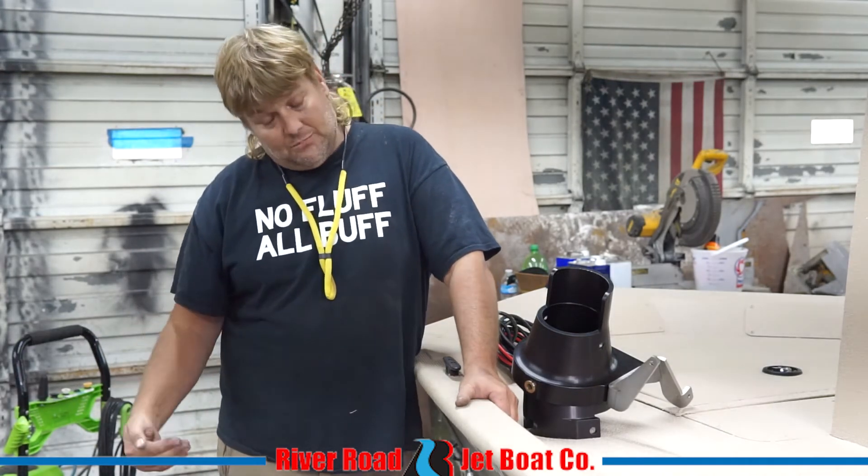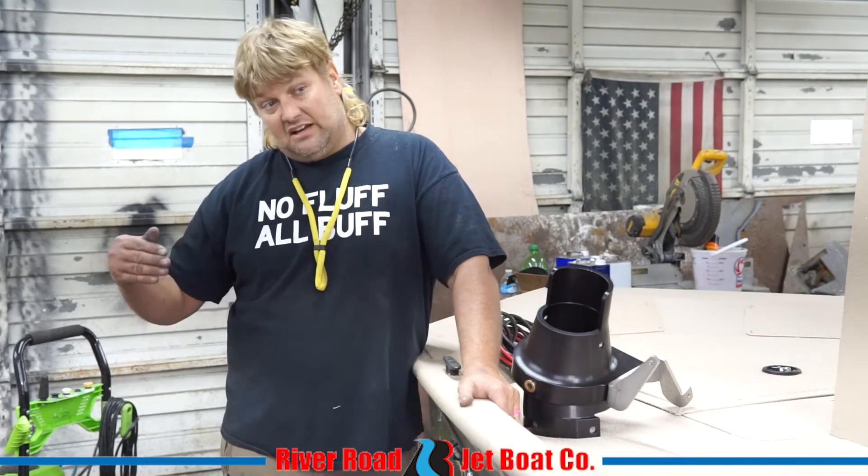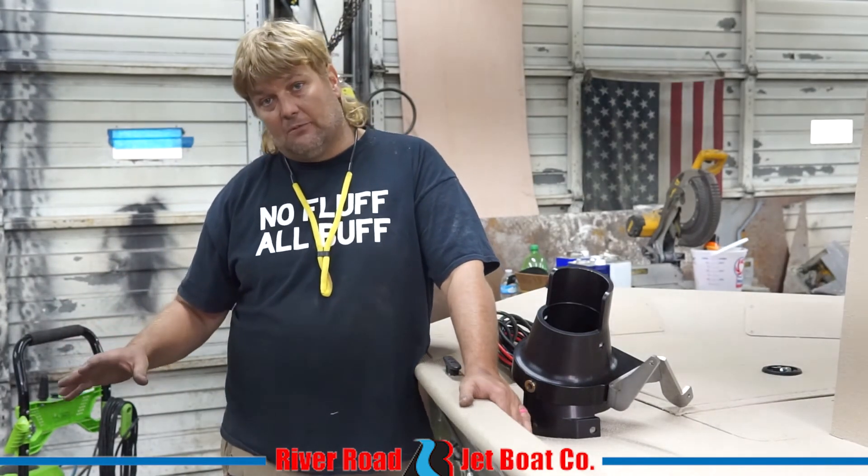I want you to take light hits because of the way the hull is presented to the bottom. If you're out in the Midwest flying and you've got nothing but sand and gravel, let's trim that thing up and really make it scoot. We're going to eliminate the cavitation, so you're going to be able to go higher than you ever were able to go before, and you're going to go faster. It's a zero drag hull with our products — a true zero drag. We have nothing hanging below the bottom of the boat. Our regular transom height is 31 inches; usually we're about three to three and a half inches above the bottom of the boat with the actual intake foot. So it is zero drag. Either way you run the boat, you're still leaps and bounds ahead of a traditional outboard jet setup.